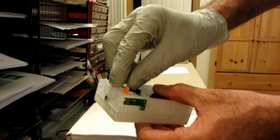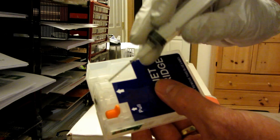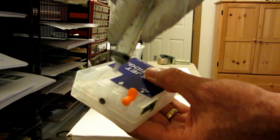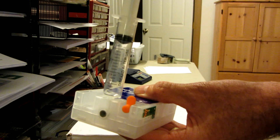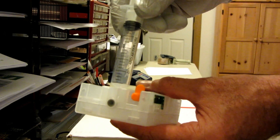And then when you're done, you're going to pull this plug out right here. You can see there's a hole right there — that's a priming hole. And we're simply going to take the syringe without a needle and just simply install it. We're going to pull back on the plunger and fill some ink directly into this syringe. That will prime the cartridge and make it ready so it can be installed.